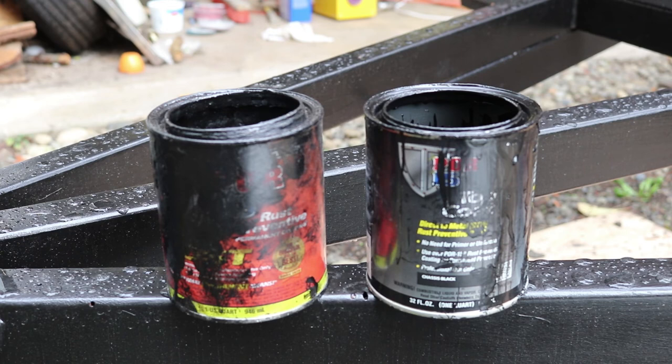I did two coats of each and I'm very happy with the results. Make sure you wear long sleeves, latex gloves, and even a respirator, because the fumes of urethane paint are rather toxic. If you get any on your skin it's very difficult to remove — you essentially have to let it wear off. There's an article online suggesting rubbing olive oil or coconut oil on your skin to help lift it off. Keep yourself protected. We're going to wait for the trailer to dry, then I'll put another primer coat on the top portion of the trailer frame and show you the results.